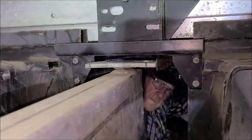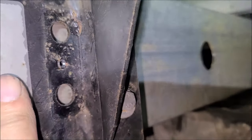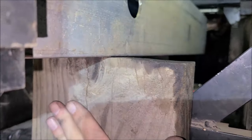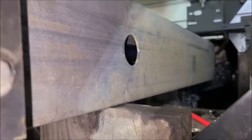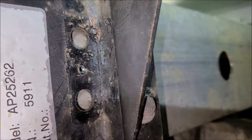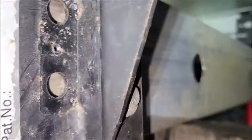All right. Now we got the top and the side to do. Let's try to see if we can get that done. Okay. See what we're doing? We said we got that pry bar. Now we're prying it the opposite direction. We're going this way so we can get more access to get the shims and the bearing on here. All right. Now at this point, can you jack up the jack again to add pressure to it so it stays put? And then we'll work on getting our proper shims and getting that screw and stuff in there. Well, it should hold. It should hold, okay.